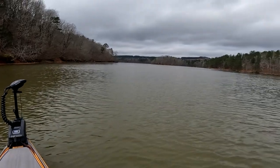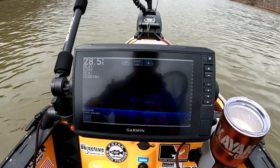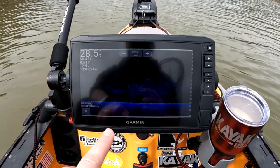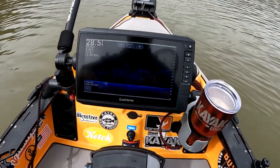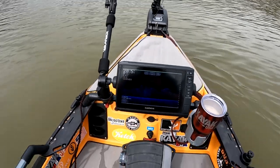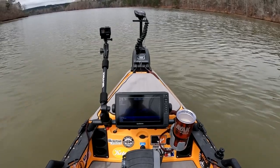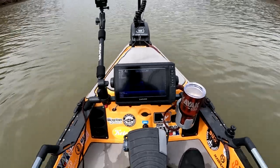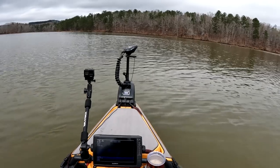Look at these seagulls — they're just dive bombing. This is just full of shad; you can see on the fish finder screen that it's all shad, and some patches are up high but most is deep. Something else I need to address: I've got some lines going straight up and down on the finder every time I turn the trolling motor, which means there's interference. The Garmin battery is separate from the Motor Guide's Dakota Lithium 100-amp battery, so I think I need to add a ferrite ring to address the interference between the wires running through the hull.